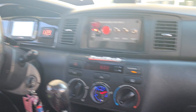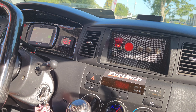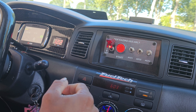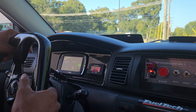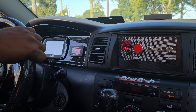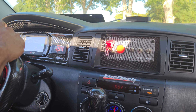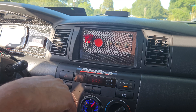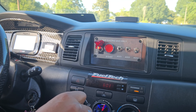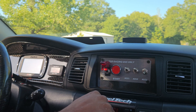Overall, at least we fixed that problem — we added some more fuel. Obviously if it goes lean you just add more fuel until she goes right. She's reading pretty well, so we're gonna go again for another pass and test the draggy the right way. It read 8 seconds for the eighth of a mile.